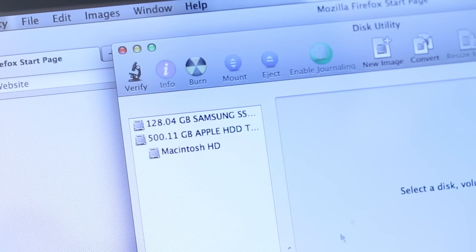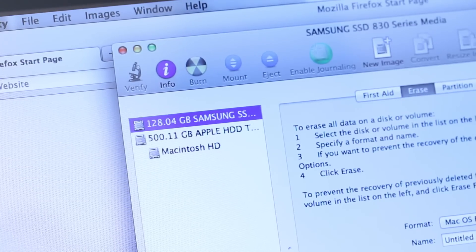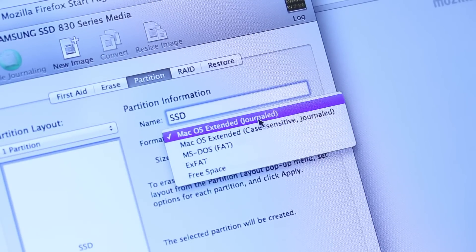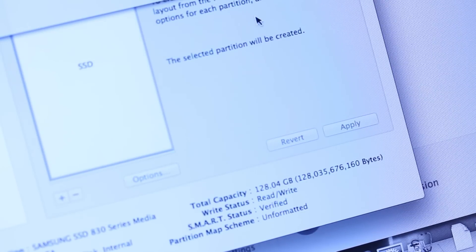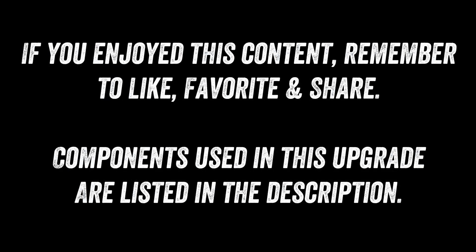After everything's installed and you boot up your system, remember you can still boot to your traditional hard drive because it's still got your files and your OS on it. You'll notice there's a new drive in Disk Utility — the SSD you just installed. You need to set it up to install your OS to it, give it a name, and format it. We'll be formatting it Mac OS Extended Journaled. The easiest way I found to replicate your installation is to clone it over to the SSD using a program called SuperDuper. You do a straight clone from your traditional hard drive to the SSD, assuming it'll fit. Then wipe out your traditional hard drive and organize files after the fact — moving media files to the traditional drive while keeping the OS, applications, and performance-sensitive files on the SSD.